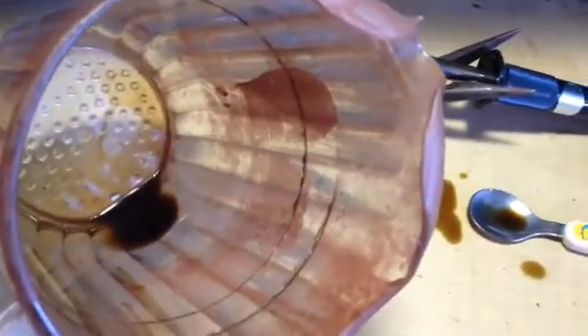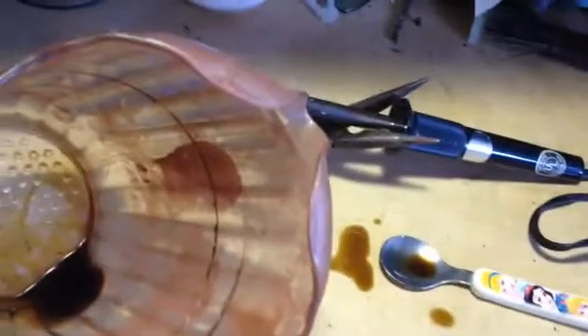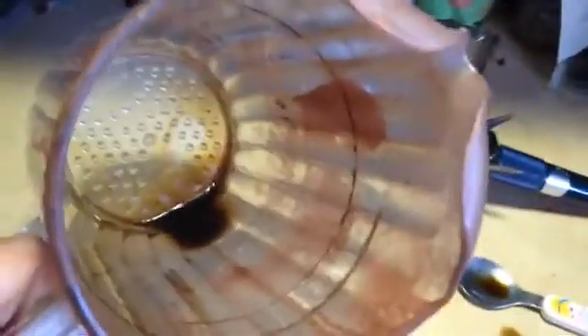To have a comparison, what I did was take oil from the bottom of the drain pan. I'm going to compare that to oil from the dipstick, which is at the top. Oil being lighter than water, the oil should float to the top and water would be at the bottom. So the oil from the oil pan should have more water than oil on the dipstick.